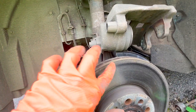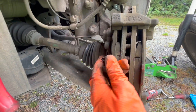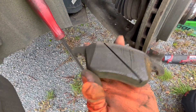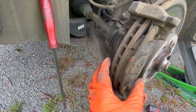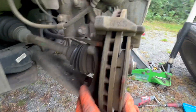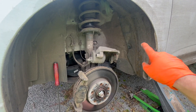The only thing I can see is it needs a clean and there's a clip missing - I'll get one of those as it'll probably irritate me. Now this front disc has a little bit of corrosion on the rear face, but the contact face looks pretty fresh. And there are my front brake pads - absolutely loads of meat on those. They're TRW pads, which are standard and the good ones. Previously at 120,000 miles I could put a new pad straight in without even retracting the piston - on an electric car, clearly the brakes don't get used much. Front suspension - everything's looking groovy, really happy.